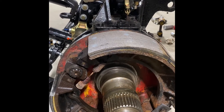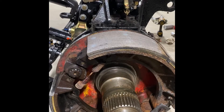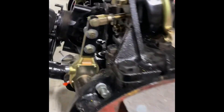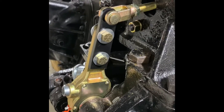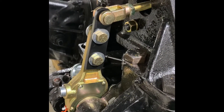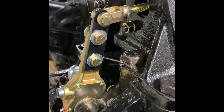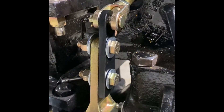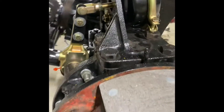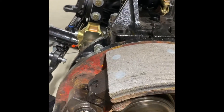From that point, I did get the air brakes done. Got the slack adjusters on here — they do not make an eight-and-a-half inch on these 10-spline, inch-and-a-half shaft. They don't make an eight-and-a-half anymore, so as you can see there's a little modification there to get it up to eight-and-a-half. I think it's going to work fine.